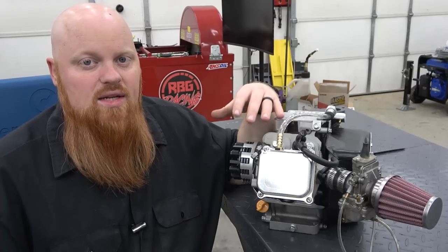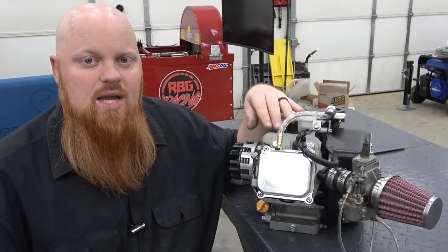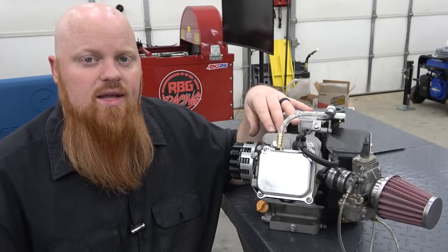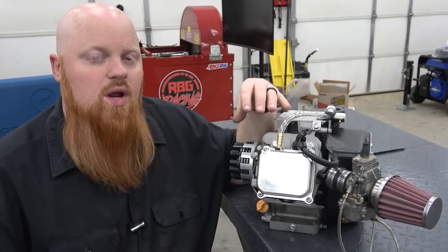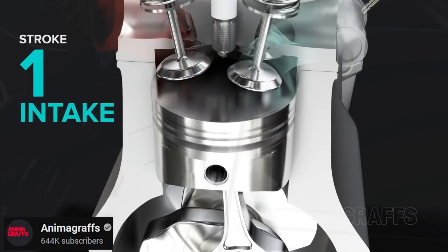So it doesn't matter if we had a ton of lift or duration, we're only going to be able to flow what this head's able to flow because of the port job. Now in our next video, we'll be porting up this head to see how much more power we can squeeze out of this engine. One thing with porting is we don't want to hog out the ports, because our valve is only going to flow as much as it can flow.